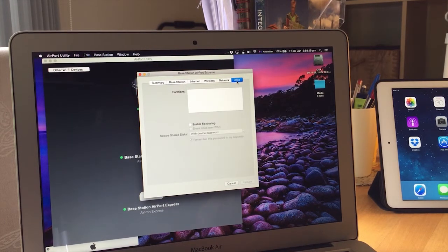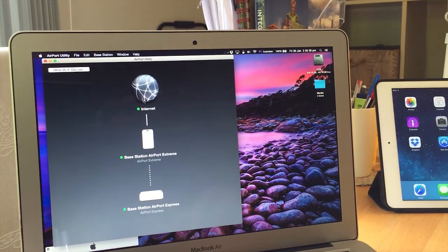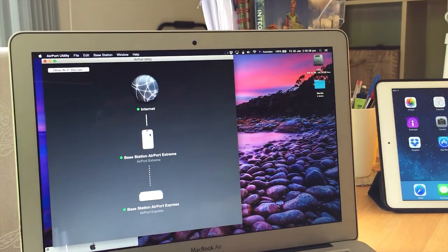You create your wireless network and configure DHCP and NAT. My Plex box has a reserved IP and everything else is open. You can also connect a disk via USB to use as a Time Machine backup - awesome. If I was doing this again I'd just buy the Apple Time Capsule with the 3TB hard drive. So the cable modem is in bridge mode with a wired connection straight into the Airport Extreme, which serves wireless for the entire house.